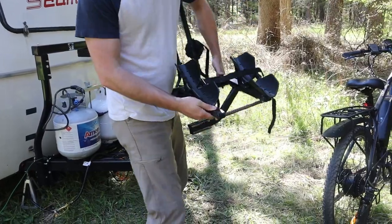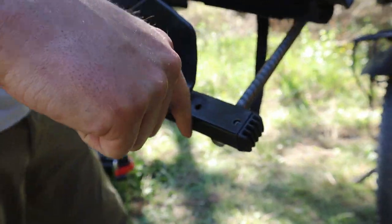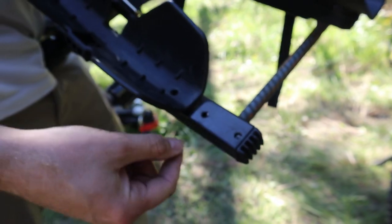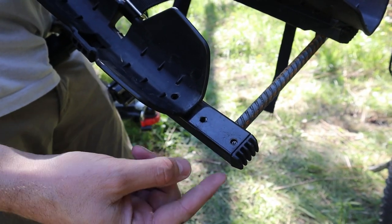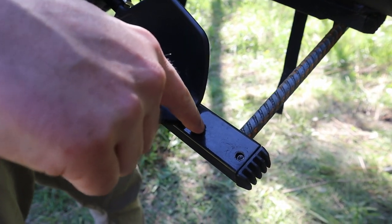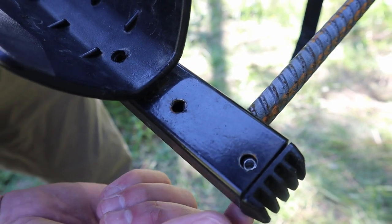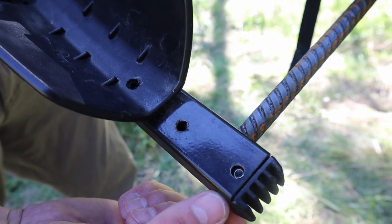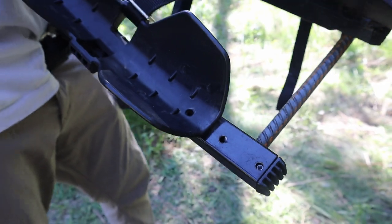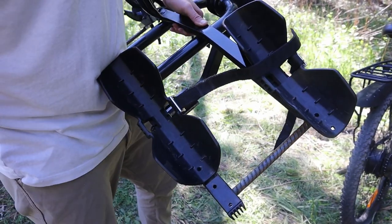When I went to drill the rivets, I drilled the holes I wanted, then came back with a larger drill bit and made this one bigger. That way when I went to push the rivet in, I didn't have to worry about it getting stuck as it was squishing down. I actually drilled right through the plastic — figured it wouldn't matter.